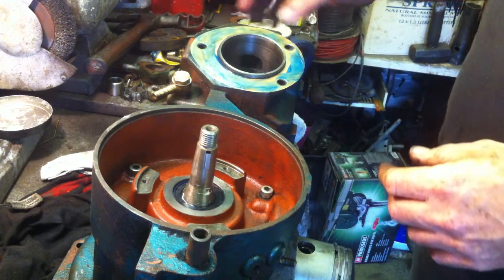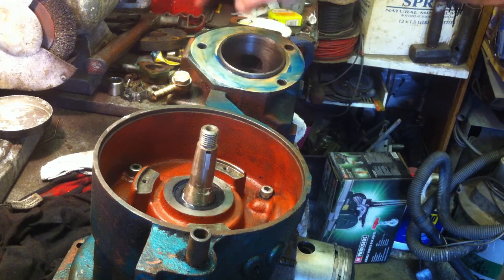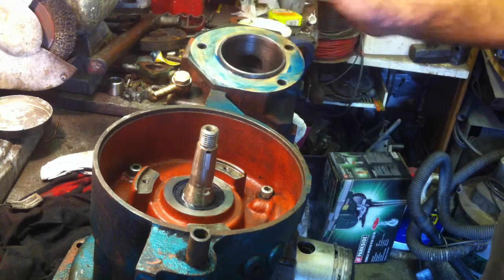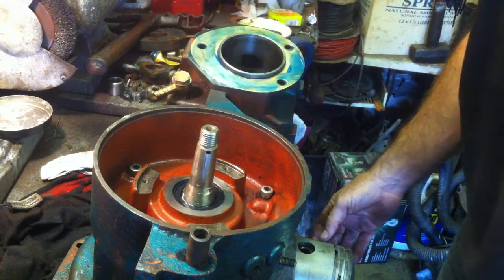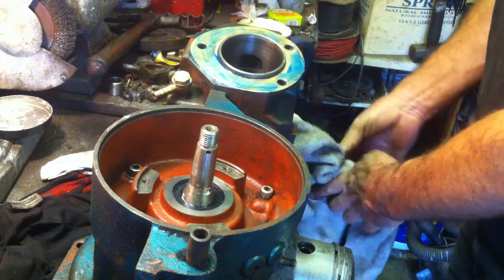I don't want chips of metal anyway. Now I've got my head pre-prepared here — I've honed it, I've oiled it, I've cleaned it off, fitted a new gasket. There's no gasket glue going to get in these piston rings, I'm quite certain of that, so that's good.